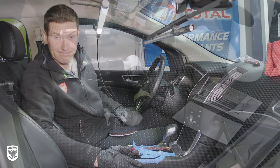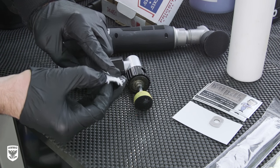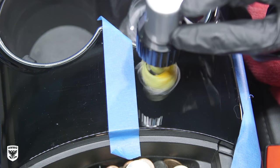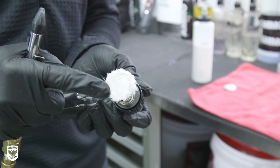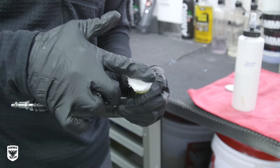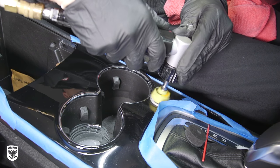Here is the step-by-step process if you're taking notes. Step 1: Prime a 1-inch microfiber cutting pad with your favorite compound, then blow it out with compressed air. Work the trim in very small strokes for a few seconds. Afterwards, blow the matted fibers clean, reprime with your favorite compound, and re-blow them out again to minimize the abrasives. Then repeat the strokes on the new area until complete.